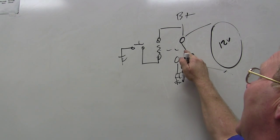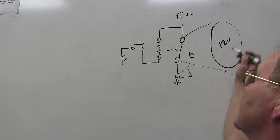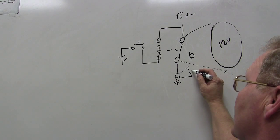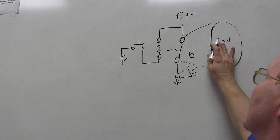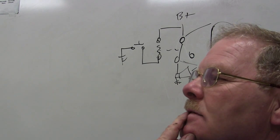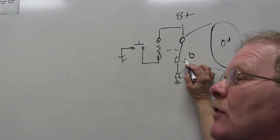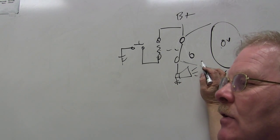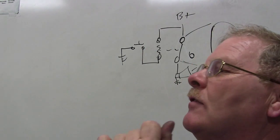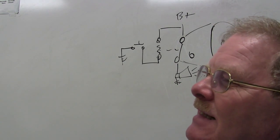All right. What is supposed to happen if this relay is closed like that? What should you read here? Two things should happen. The horn should go honk, and this right here should drop to zero. Because, if there's any voltage drop, you're going to read some voltage. If you're reading 12 volts with a relay closed, what's that telling you? You're dropping all 12 volts. You're doing a voltage drop test on the relay, and the relay is actually dropping volts.